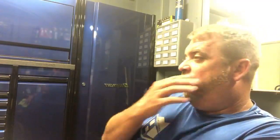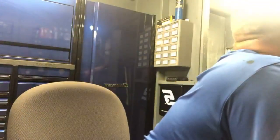Yeah, I got to do the M12. I don't know how we're going to measure 250, because to get that type of dry torque out of it, we have to have a 5/8 bolt, which is 7/8. That's 240 dry foot-pounds. I guess I could do wet torque at 298. We could do 5/8, 18. That's a big fucking hole. But we can see if we can do it. Again, I ain't got time. Oh, what the fuck? Shit just falls down everywhere.